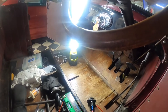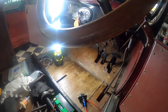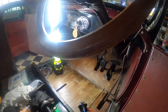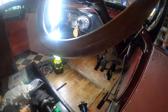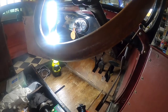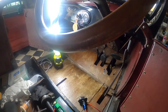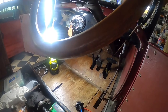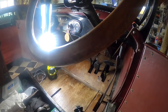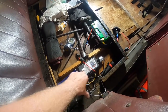When I bought this car it had been converted in the 70s to run on 12 volts - it was running a modern coil and a modern distributor. It wasn't one of the angled drives that most Model T guys know - they used a Lucas distributor cap with a base that mounted on exactly the same spot as the timer. But it was rubbish, so the decision I made was to convert this car back to 6 volts as old Henry made it, with coils and the magneto.